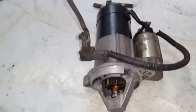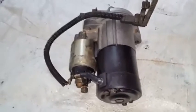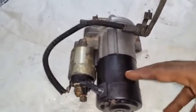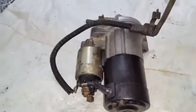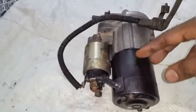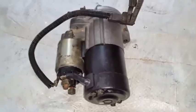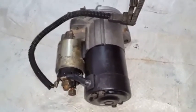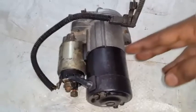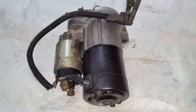We will now reinstall the refurbished starter. If it continues to demonstrate the same failing sound, we will then have to replace the electric portion of the starter motor. Sometimes the coil field inside the armature and the magnet which is attached to the outside casing will become weak in its static ability, causing a weak motor. We will then proceed and replace this electric portion if the starter continues to give us a fail condition after checking all terminal connections and battery voltage.